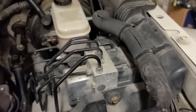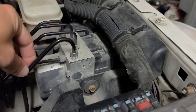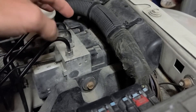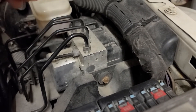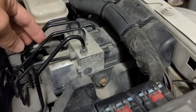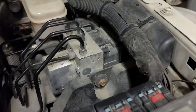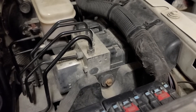The good news is this module is actually composed of two pieces. There is the HCU — this is where all your brake fluid and the control valves for the ABS run from — and back here is the actual computer, and they are separate. A lot of people think they need to buy the entire unit and then go about bleeding the brakes and doing a bunch of other brake work. You don't need to do that. I'm going to show you how you can get this out using this bolt here, prop this out gently without breaking or bending your brake lines, pop this off the back, just replace this piece, and then there's some reprogramming that needs to be done. I'm going to see if I can do it without going to the dealer using Alpha OBD, and if I can, I'll show you the steps.